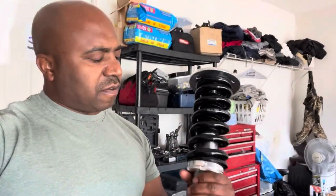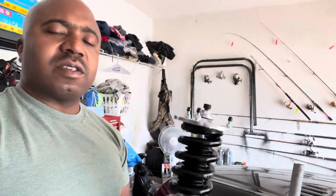Hi, this is Brandon Green, owner of Goldell Autoworks. I'm currently working on a 2004 SL55 right here. I'm doing a coilover swap with Silvers Neomax. This is with the standard spring rate. No rear extender. No super low kit. Lately I've heard maybe two or three stories of people who have installed these Silvers Neomax coilovers onto the SL55 and had an issue with a popping noise when they turn. It's only in the front, not in the rear. When they turn, they hear a loud pop or a loud crank.